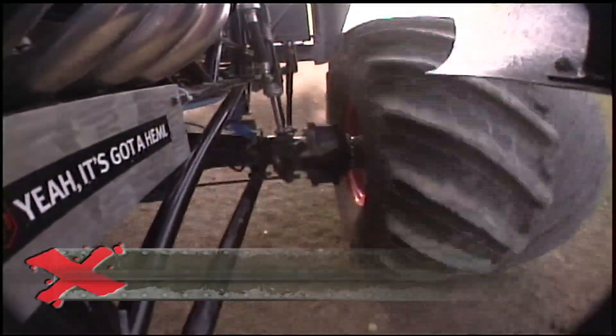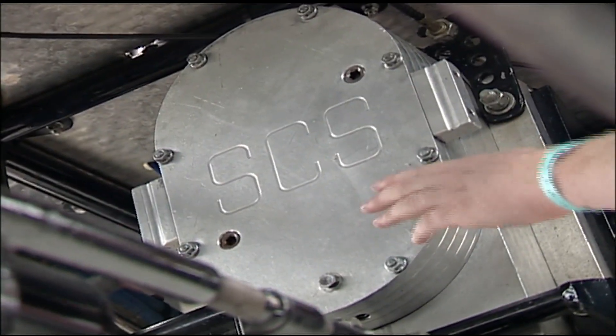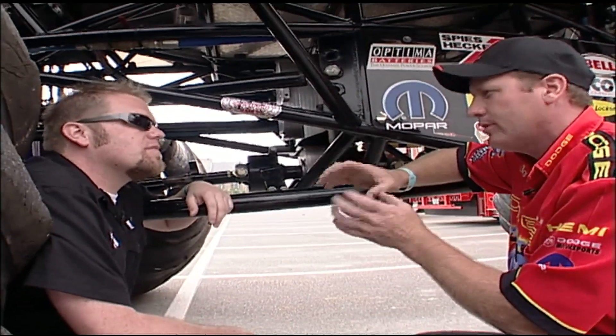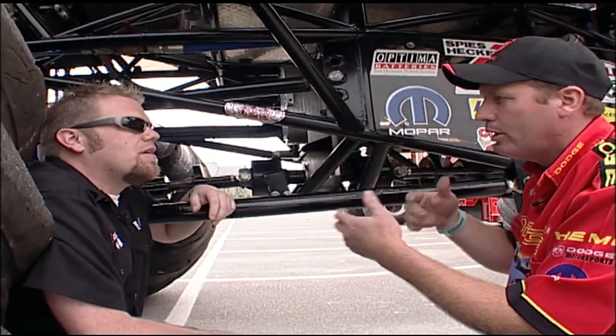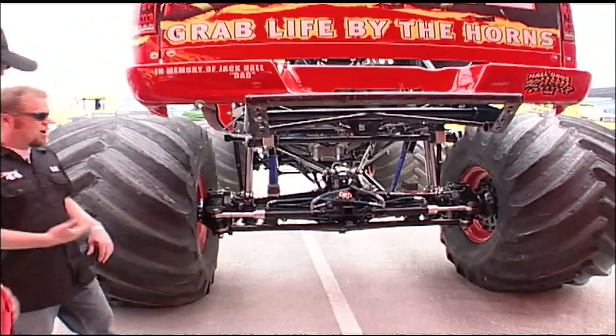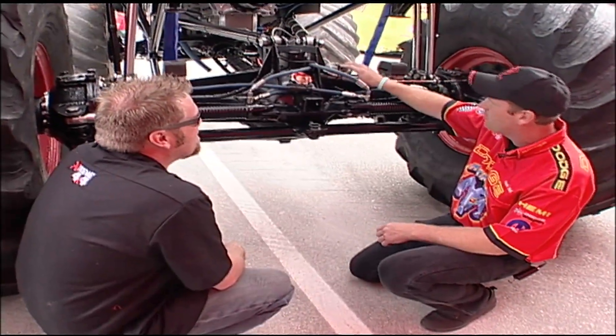The coolest part of the drivetrain to me is the transfer case — it's really different from every other truck. It's a quick-change rear end with a 16-inch drop. You take the back cover off and it almost looks like a stock car quick-change rear end. There are gears in there and we can change the gear ratio depending on how long the course is and what we're doing. One thing people have seen in rock crawling but that's always been in a monster truck is the rear steering. We have a rocker switch mounted on the left-hand side of the seat. If we're going to make a left-hand turn, we hit that switch to the left, steer to the left, and the rear wheels actually go to the right so it makes us swing around. A few years ago we came up with turn-to-center, which helps a lot — it takes the guesswork out. When you let that switch off in the cab, switches under this cover will turn it back and run the wheel straight.